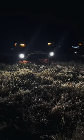And since I've had this car for the past 2 years, the windshield washer system is the only thing that has been giving me consistent problems. The hoses that connect to the nozzles or the sprayers under the hood have disconnected multiple times, and then this happened. So I'm not sure what's going on, but I've zip tied the connecting points for the nozzles and for the tube that connects to the actual reservoir itself to keep that from happening again, because it's frustrating running around with a dirty windshield and you can't clean it because you don't have any water. But yeah, so far that's the only issue I've had with this car. It's quite annoying.